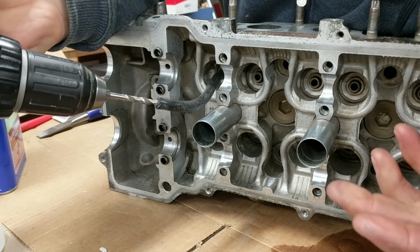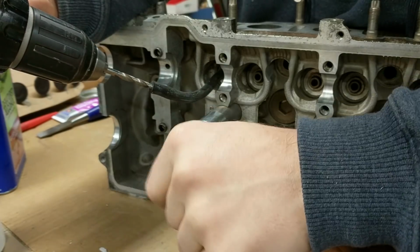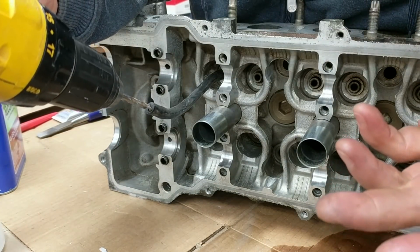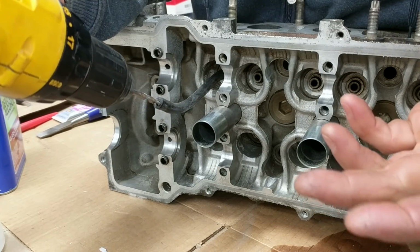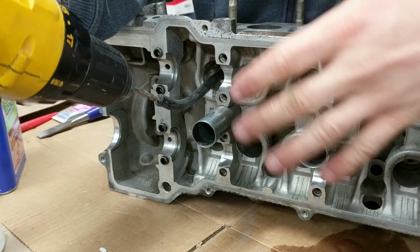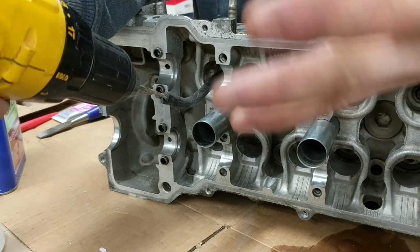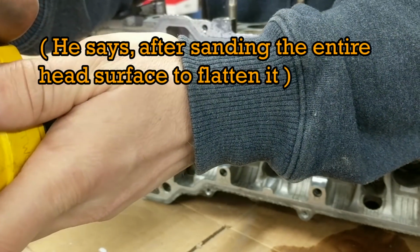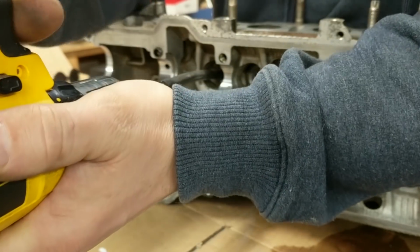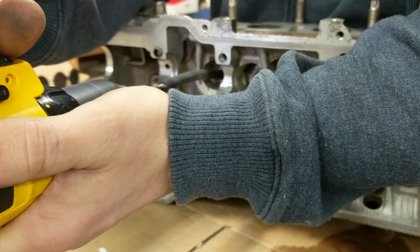This is what I'm doing. I don't know if this is right. It seems like maybe I'm doing too much grinding here with this stuff. The danger here is that you end up with like a rounded surface. Anytime you use sanding operations, it doesn't leave it completely flat. Machining leaves stuff more flat. When you sand, it tends to kind of round things over. So I'm gonna reverse it. Don't ask me why, it just seems like the thing to do.